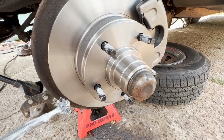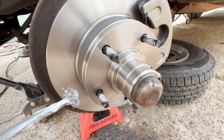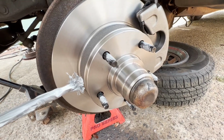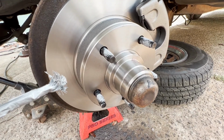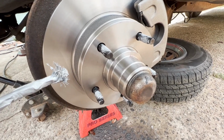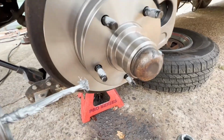So in this case, and it does often work, you can gravity bleed it like that. It just has to have some fluid in the system to start that siphoning effect. So fluid has to be in the lines. If you put a system together from scratch, it's not going to gravity bleed. You know, it would be dry everything. Anyhow,